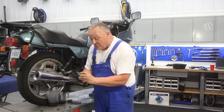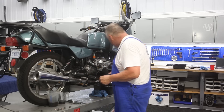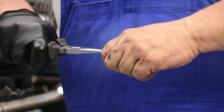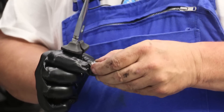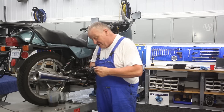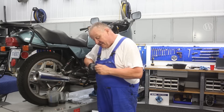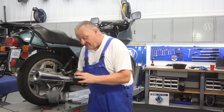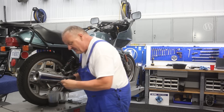Taking the old crush rings off the plugs — they're pretty mashed down. Sometimes these crush rings get mashed down and perhaps over-tightened. When I took these plugs out, I was able to see that the threads are in really good shape, so that's lucky on this bike — and we want to make sure it stays that way. There's all these little mysteries you uncover when you dig into a bike you've never worked on before — this one actually had two crush rings on there.